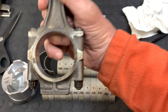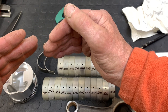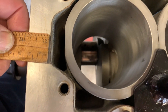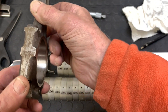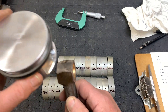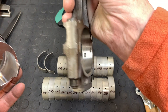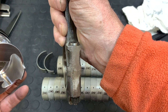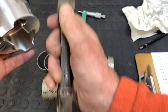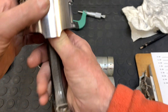So if we're on the A side, the A bank is offset about a connecting rod's width from the B side. So it's going to be on the back side of the crank pin. You're going to install this bevel back, and then the piston with the arrow pointing to the front. The B side would have the opposite — the bevel would be forward, because the B bank is a connecting rod's width further forward than the A side. So the bevel would be there, the arrow would be pointing forward, and it would go together like that. Really important.